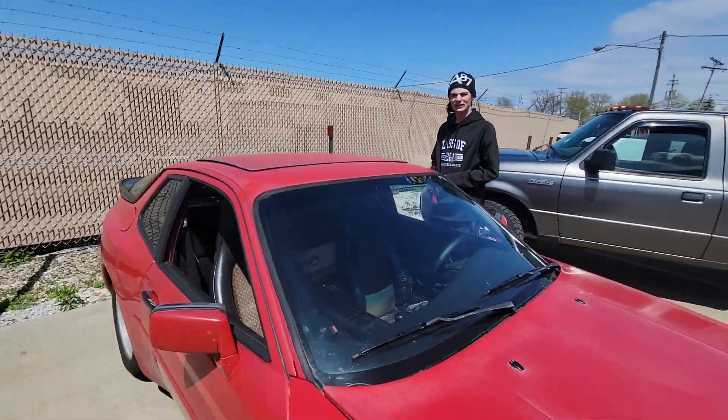Welcome back to Temper Customs. On this episode we're going to see what's wrong with Andrew's car. We fixed the half shafts a couple weeks ago and he's been driving it to work fine. This afternoon when he went to leave work, it cranks but it won't start and he doesn't hear the fuel pump. I just left work early to go to his work, which isn't far, and see what's going on. He checked the fuse and it looks good.